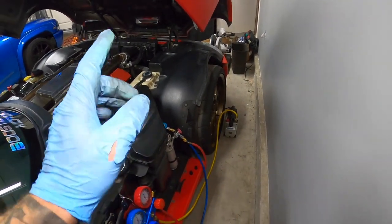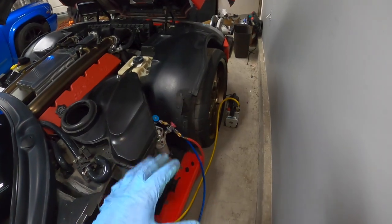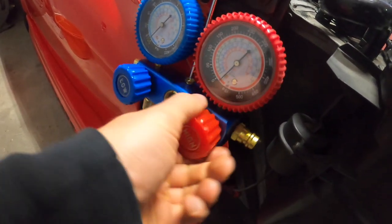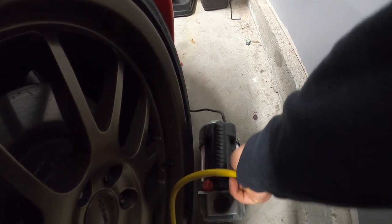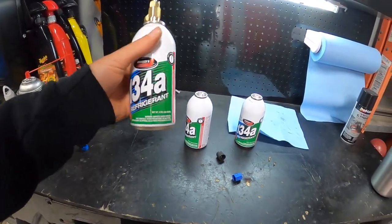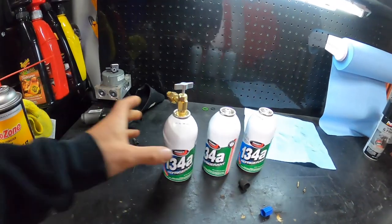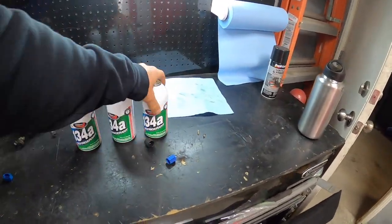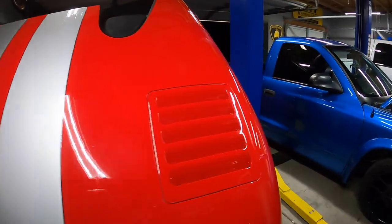We're using the vacuum pump and pulling a vacuum on this. I have a separate video completely on this, which I will link. We've been pulling a vacuum for about an hour. We're going to close these two valves, shut off the pump, disconnect the line, and hook up our R134A. I had to go get another can — you will need three cans. It's 1.81 pounds, which works out to 821 grams, and each can is only 340 grams. So we're going to put in two full cans and then some of the third, using the pressure charts to calculate the last bit. Let's start the vehicle, turn everything to max AC, and start getting those three cans in there.